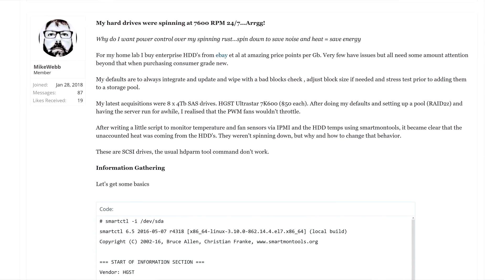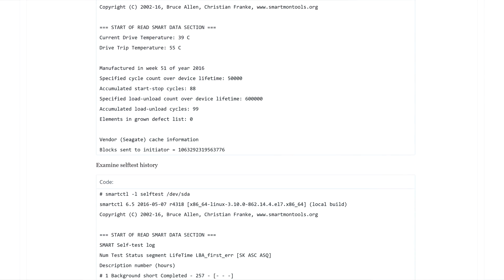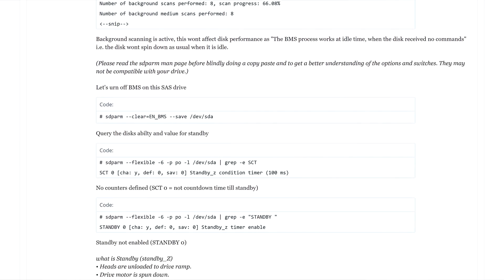I wanted to make these older drives use a little bit less power if possible. Per drive, these draw about two times as much as the 10TB IronWolf drives. The 3TB HGST drives being SAS drives, they have a lot more configurable options than normal SATA drives. One of those modes was a special low power plus low RPM mode. That means the disks don't have to spin down and up completely, but can lower their RPM at times where there isn't a lot going on. There is an excellent forum post on ServeTheHome about how to do this yourself — I've linked it in the description.